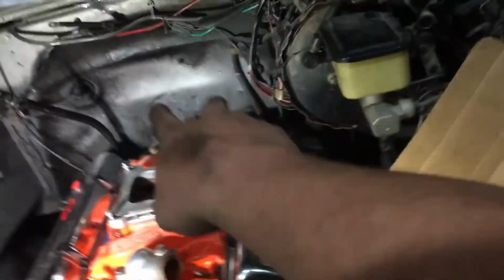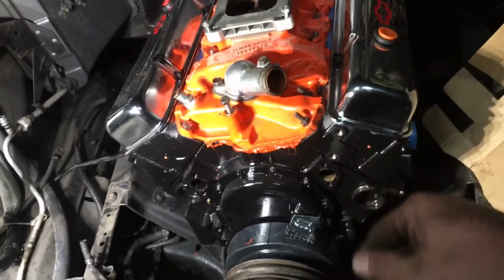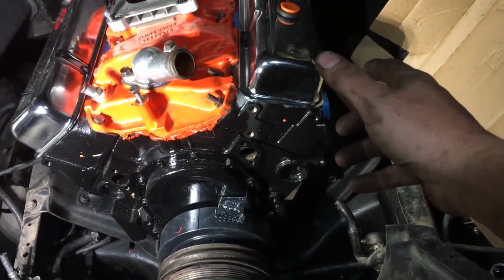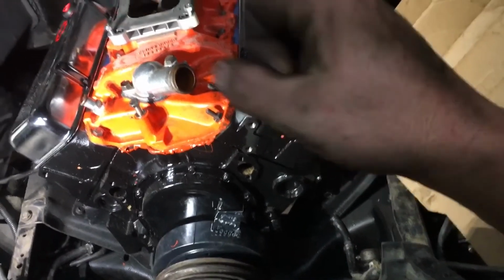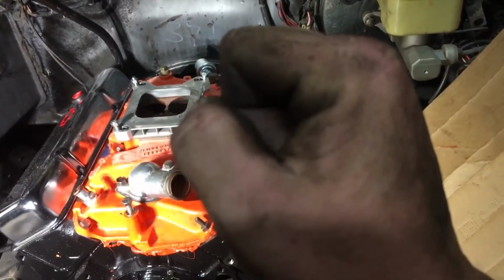So that's what the deal is with that. The way I do it is stick something in the spark plug hole. Wait till I feel the piston come up to the top. Wherever I think the top is. Now, you realize the piston comes up and turns around and starts coming back down. I'm trying to catch it up here at the top somewhere.